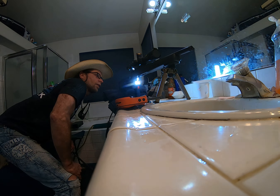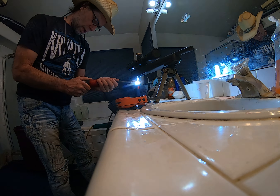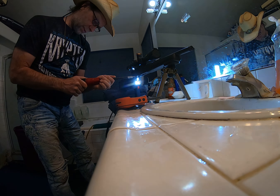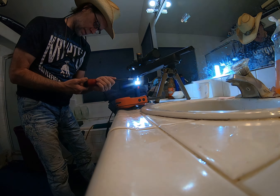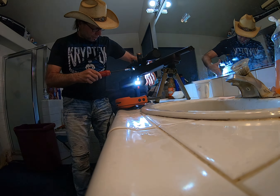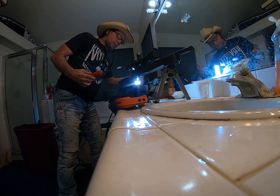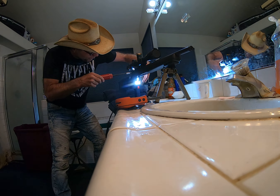These are 30 inch pounds. We're going to take this handy dandy torque wrench and turn it up. It's at 25 — we're not going to go quite 30, we're going to go like 28. I just don't trust torque wrenches. Okay, we've got 30 set on this. We're still good — I banged into it a little bit, but we're good.